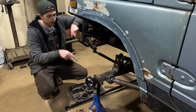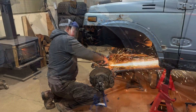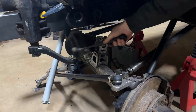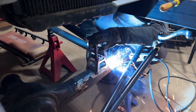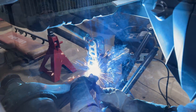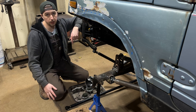To get the proper six degree caster angle, I actually had to chop off some of my tack welds for my upper mount. That let me rotate the housing to get to that proper six degree spot. I was then able to dial in my upper link lengths for the proper thread engagement, and then re-weld that upper mount in the correct position for six degrees of caster.